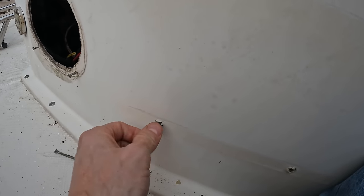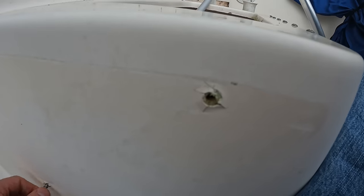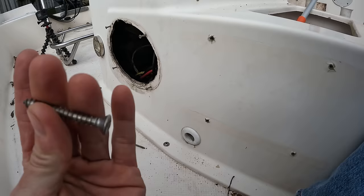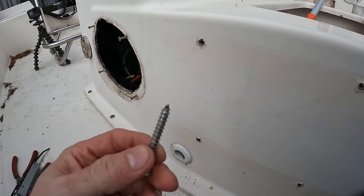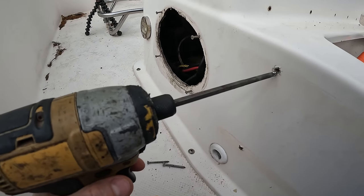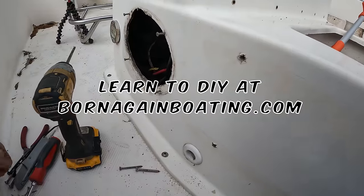But it's not really a true fix, because what happens is exactly what you can see here — it's all bulged out and pulling out, ripping the gel coat because you just ran a bigger screw in there. So if you do put a bigger screw in, you need to countersink the hole. You can do that using just the Phillips tip on your bit to round it out depending on how big the hole is.